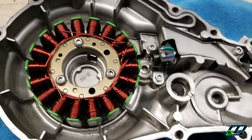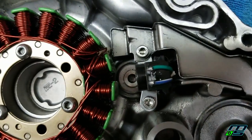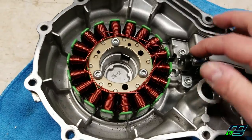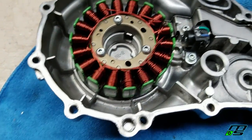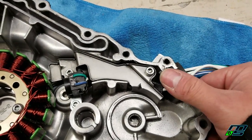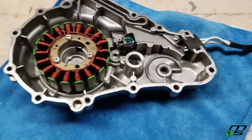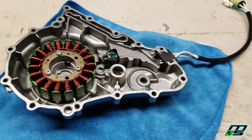Okay, so it's all on there, nice and tight. I managed to make it fit and hopefully that'll work. I think it will — I don't think there's gonna be an issue with that. All this other stuff fit real nice. The grommet fit in there nice after I shaved it down. I already put some RTV in there, so I'm gonna throw some gasket tack on and my gasket, throw this cover on, put some oil in it and we'll see what happens.